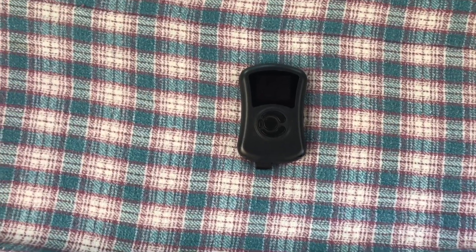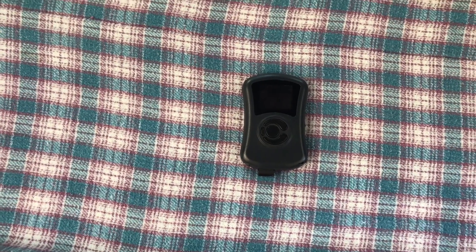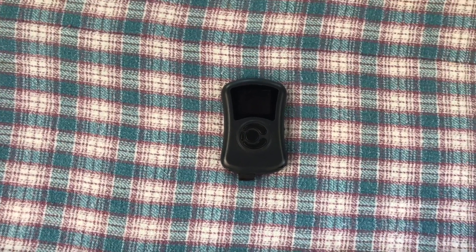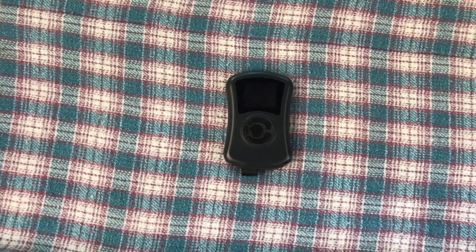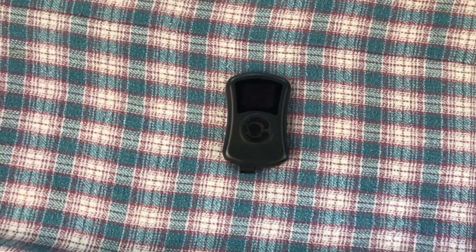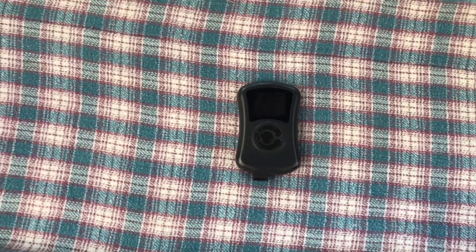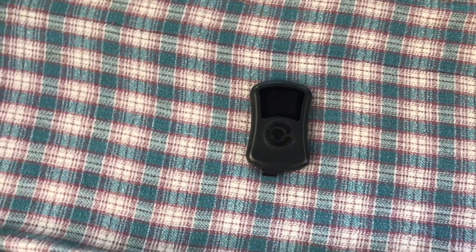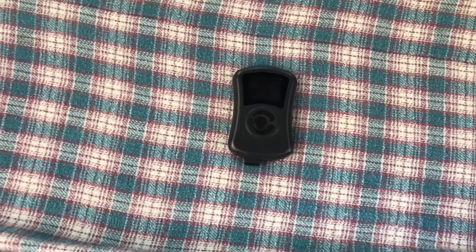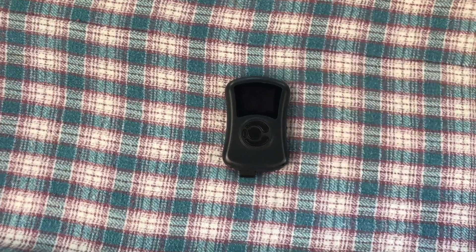And what I'm going to show y'all is it's bigger than that — it's not just reading live data. It's a cheap way for you to read live data on any car, so it doesn't have to be ones that are compatible with the access port line. You can use it on any car. I plugged it into a Miata the other day and I was able to get a bunch of live readings. You can look at how your car is running, maybe diagnose some issues. It can even read and clear trouble codes, which is really important.